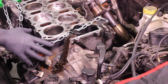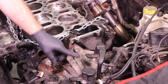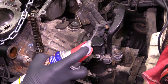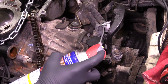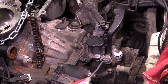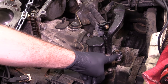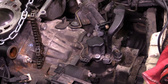Now we're going to start with removing all the stuff attached to the transmission. That's going to involve the shifter cables as well as the bracket that holds the cable on and the slave cylinder as well. I am going to put a little WD-40 on the shifter cables. This plastic can get really weak over time, so I want to do everything I can to prevent breaking it. One special note about this bolt right here — this is not a regular bolt, this is a specialty bolt. If you put a regular bolt in here, you'll never, ever get it adjusted right.